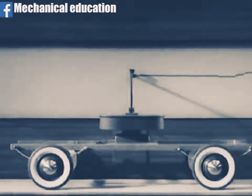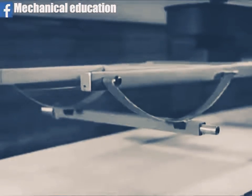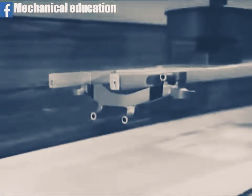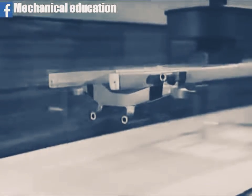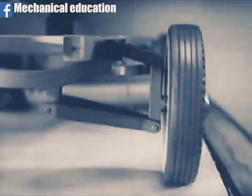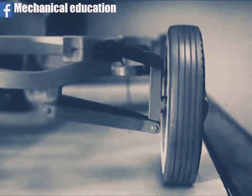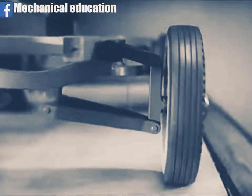The trace line shows this clearly. The only way to eliminate this unequal springing and make the front springs soft is to give them only one job to perform: the job of absorbing bumps. Suppose we replace the bouncing axle with a rigid, immovable beam. Now the wheels can be fastened to the beam by two parallel swinging arms. The wheel is pivoted so that even when the arms are tilted by a jolt or bump, the wheel remains vertical and in perfect alignment.